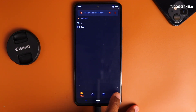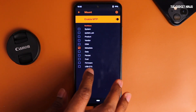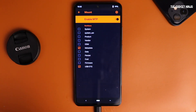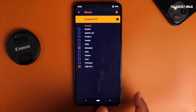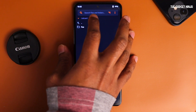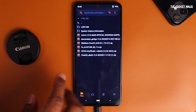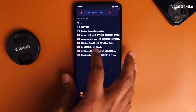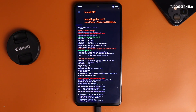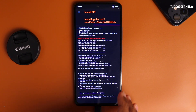The next step is to take your charging cable out and attach the pendrive to your phone via an OTG cable. Then go to the hamburger menu icon, then Mount, and tap on USB OTG. If it is not tappable, unplug your pendrive and plug it again, unplug your OTG and plug it again — it should work. After that, go to Files, tap SD card, then OTG. I'll select the OFox unofficial zip and just swipe to install. In a few seconds, Orange Fox should be installed on my phone — and it's done.